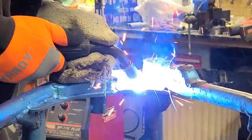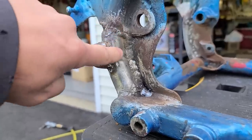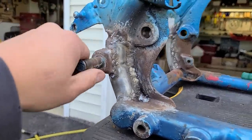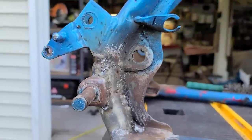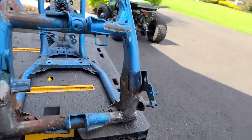Working with dirty metals really makes welding a pain. I'm like an okay welder, but if I don't have clean pieces of steel the welds just come out ugly. But you know what — they always hold. It is ugly, but it's gonna hold. That piece of pipe I bent had a little wrinkle in it — I packed it with sand. I just got a new pipe bender and was testing it out. I had to cut off the brake pedal stay piece and re-weld that back on. When it's sandblasted and powder coated it's not going to look quite as bad.